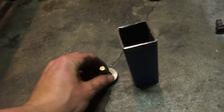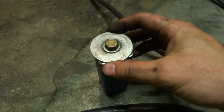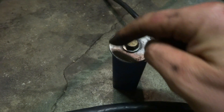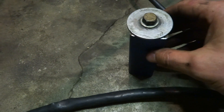Very simple. Remember, this is a budget build, but I don't see any reason why, if the welds are good, that wouldn't solidly hold the engine in place while we're drifting. Feel free to let me know in the comments below if you think that's a terrible setup, but that's what we're doing. So let's weld this thing up, cut it to size and chuck it in and see if my theory is correct. We've got our trusty gasless MIG set up. I've actually found an appropriate size washer as well, so I'll weld around here, flip it upside down so the bolt's sticking up, weld around, and then that's our engine mount welded.